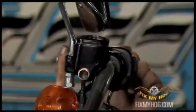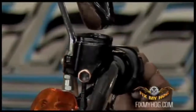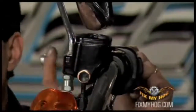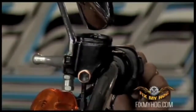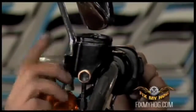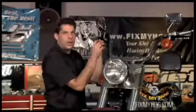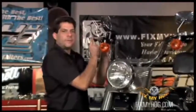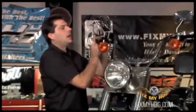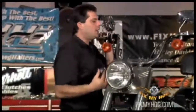You'll note that by using a Phoenix injector, you'll almost have brake lever feel immediately, due to the fact that you forced the fluid from the caliper up the empty line and into the master cylinder reservoir. Most all the air will be gone at this point. I can pump the lever till I have good lever feel, then double check my reservoir to make sure there's a sufficient amount of fluid in there.